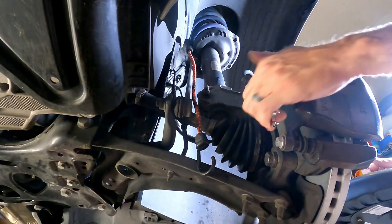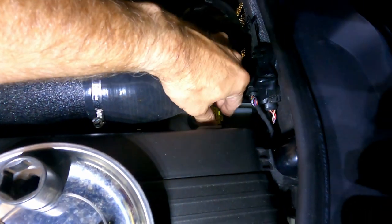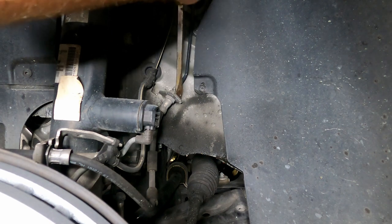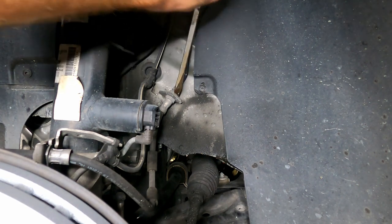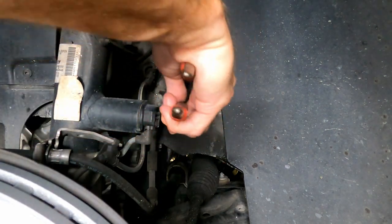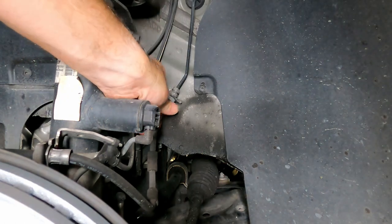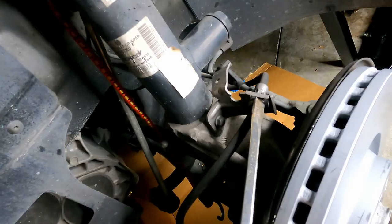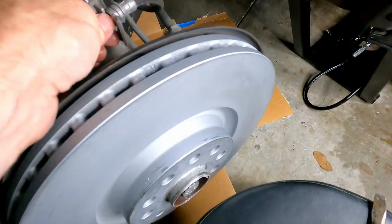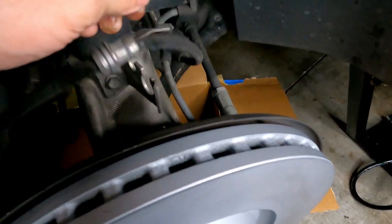For the brake lines, I'm cracking open the brake line connections to make sure they're not rusted tight. I'm tightening down the master cylinder cap, which will greatly slow the flow of fluid once I start removing the lines. Then I remove the little retaining clips using a screwdriver rotated through and grabbed with channel locks. There's also a second clip that holds the entire line in place. Once both clips are out, you're good to go ahead and remove both ends of the brake hose.